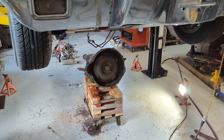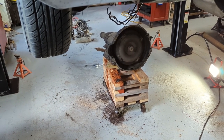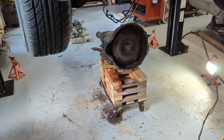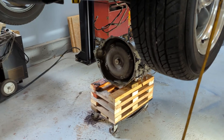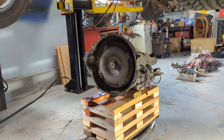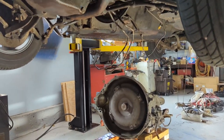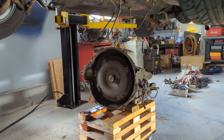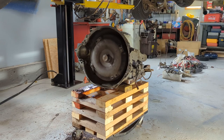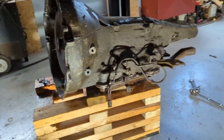This is just a rough overview — it's not meant to be a hardcore tutorial showing you how to do everything. Some stuff you'll have to figure out on your own because each vehicle might be a little different depending on who was working on it last. I'm going to go get the Cruise-O-Matic and put it in — it's just reverse order. I want to clean up behind the flex plate. Practice safe working under vehicles, clean up your oils as you lose them, and be careful — these are heavy. Before you try to pull it off the stand, take the torque converter out — you'll take a lot of weight off.